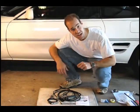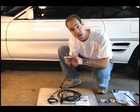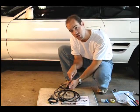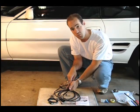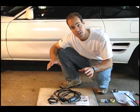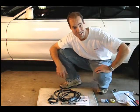This is Innovative Motorsport's LC1 wideband kit. It includes a Bosch wideband oxygen sensor, and integrated into the cable is all the circuitry we need to adjust that wideband sensor signal into something our laptop can understand and data log that air fuel ratio. Let's get this thing installed and go get tuning.